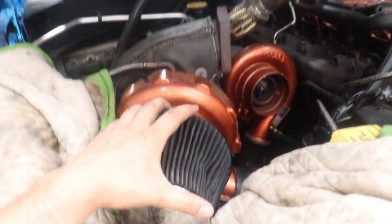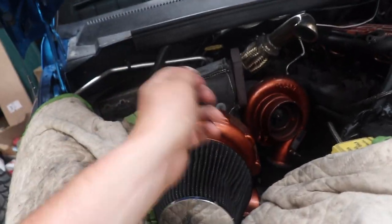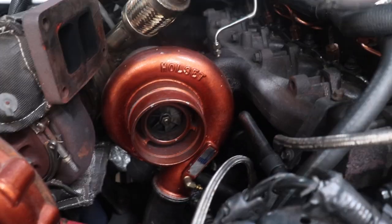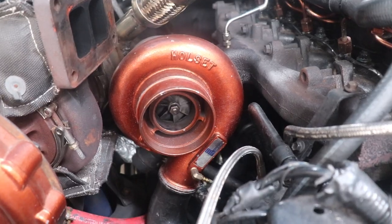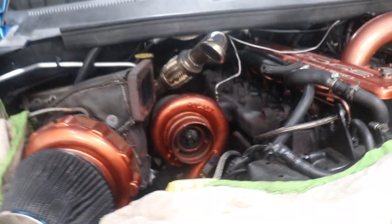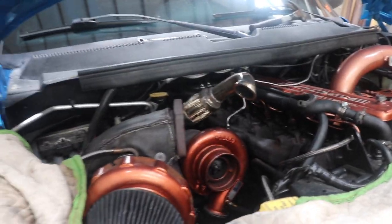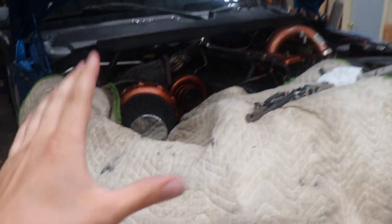I did check the turbo wheel on the other one as well, like I said in the other video, totally solid, no play, no slack up and down, side to side, in and out, like it's a very snug, free spinning wheel, very nice. This one, however, not so much, metal on metal contact, it's not good. So I limped it home, about a 10 minute drive from where it started making that noise, and we're getting this all ripped apart to get the new HX35 put in.